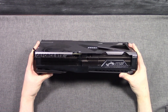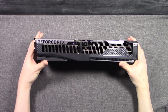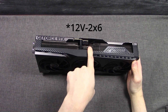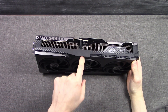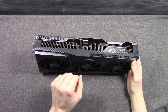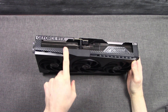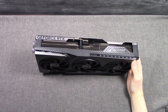At the top you will see this uses the 16-pin 12-volt high-power connector. This does come with an adapter in the box — a three times eight-pin adapter. If you do not have a 16-pin connector, you can use the three 8-pin adapter. You can also plug in a straight 16-pin cable here and a 450-watt cable will work on this just fine. This is a 360-watt TGP video card, so a 450-watt 12-volt high-power cable should work fine. There are two levels on power supplies — 450 or 600 watt — but 450 should work on this. You can overclock it and bring the TDP up to 400 watts.